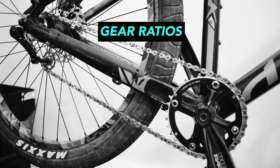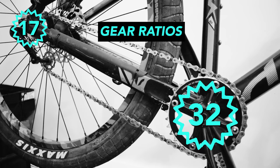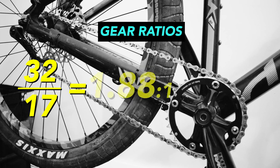The setup of this bike is 32-17. 32 teeth on the front and 17 teeth on the back, which gives a ratio of 1.88. Let's go and see how this gear ratio performs on flat road and uphill riding.